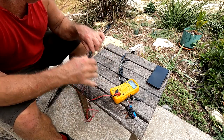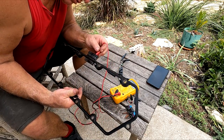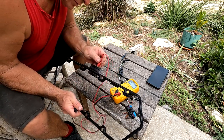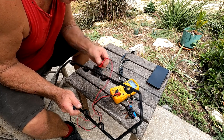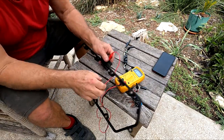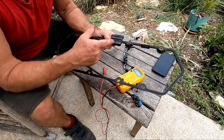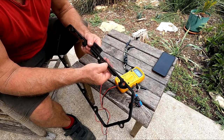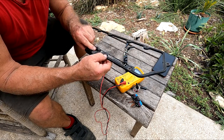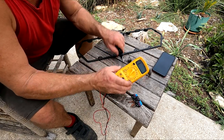The valve cover is just a pass-through with connectors, so I put an alligator clip on one end. You can hear my dog barking in the background. You just keep doing that on all the conductors. The common one is the neutral, which is the middle one — obviously if that one fails, the whole bank goes out. Run through all of them, check that you get continuity. These might not typically go bad, but we changed it because the silicone gets a little dry on older ones.